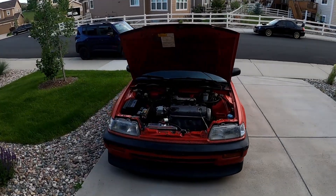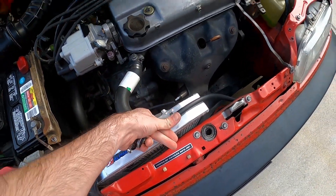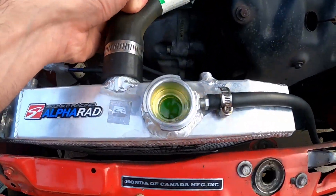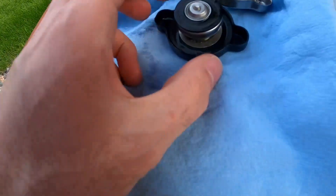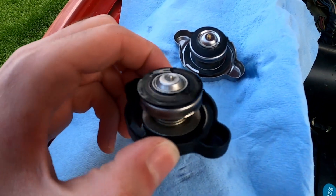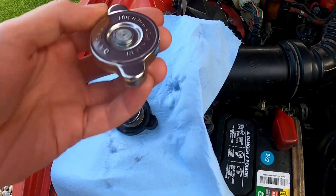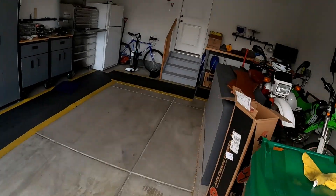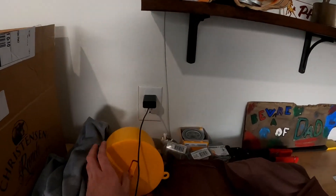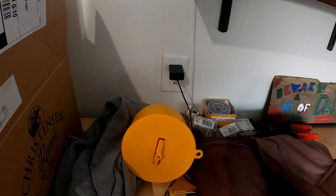Posted on a Facebook group and that's what those guys told me to do. Make sure it's totally cooled down — I can put my hand on top of the cap, but definitely wait; don't do what I'm going to do. It was actually pretty anticlimactic, zero blowover. Brand new coolant because we just did the water pump — it's right up to the top. The old cap is basically brand new but it's definitely harder to push down, so it's definitely the higher pressure. I'll start it up and try to get some bubbles out if there's any air. I've got this fancy bleeder funnel — the highest point in the cooling system to make sure all the air comes out. I've done that two or three times and it doesn't change anything.